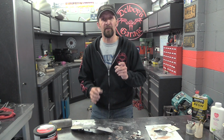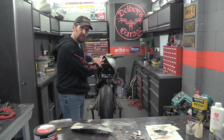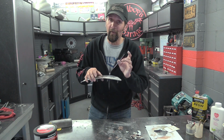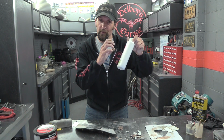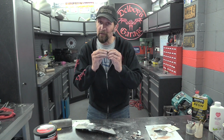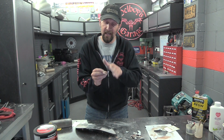It would have a use though, I think, if you were making a plug. If you were going to make a plug, a mold, something like that, this sacrificial plug, an original piece that you're then going to take a mold from, then that's great, because one property it has is it's super fine. Obviously the size of the granules in talcum powder are so tiny that the filler it makes is super smooth, even without being sanded. Very, very fine, almost like a ceramic, and it sands down nicely.